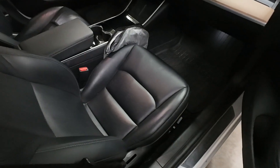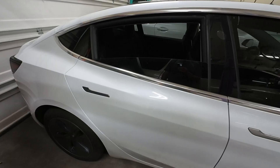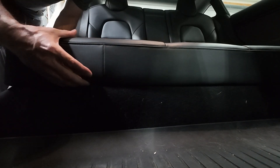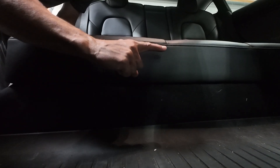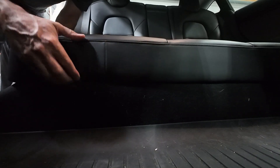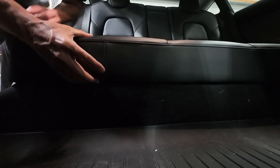You can move the passenger seat up to give yourself a little more room. Step into the rear passenger door — this is the back seat. Run your hand along here until you feel the latch, and slide the latch that direction. There's one latch here and one on the driver's side. Move the latch and then just lift up. Same thing on the other side behind the driver's seat — find the latch and slide it that direction.